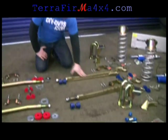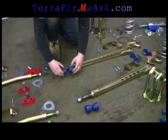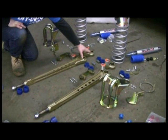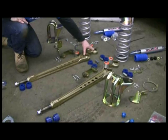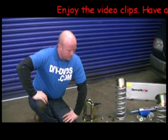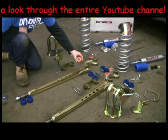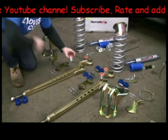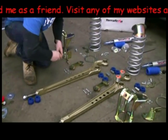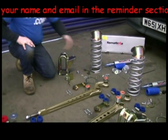Front arms — different grey Polybush for the back end of that. Smart bit of kit. These are the Terra Firma cranked ones. They've already adjusted for the two-inch lift. Two-inch lift is just about when you start to change the angles of your front axle — I'll explain that as we go. These are the caster correction bushes if you're using your original arms. You can see it's off-centre. So we're going to stick them in the old arms. Bump stop spacers for the front — same as the rear.